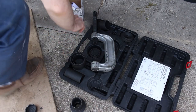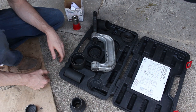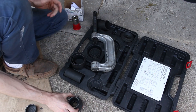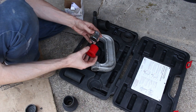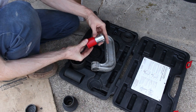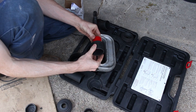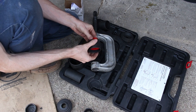All right, so I rented this ball joint press at my local auto parts store so that I can press out the pivot bushing and press it back in. I've got my replacement pivot bushing here, and I sized this socket. It's a 30 millimeter socket. It's just a smaller diameter so I can press it out with that guy. And then this bigger size will press it right through here, because this retaining thing we need to press out.